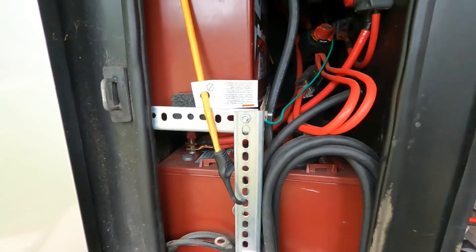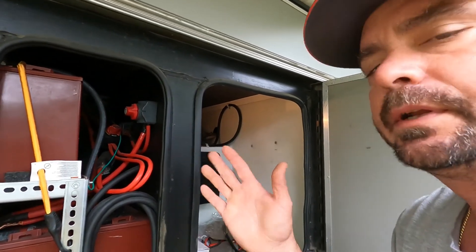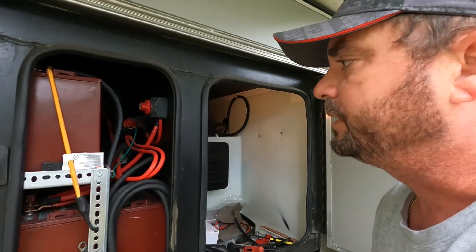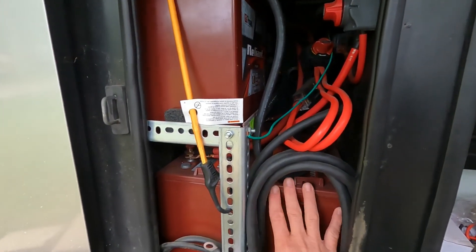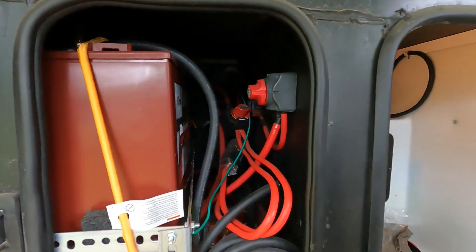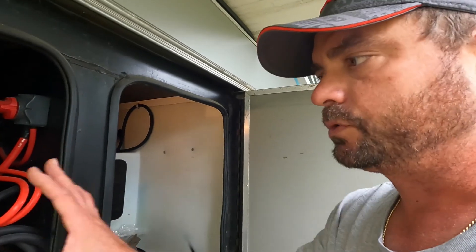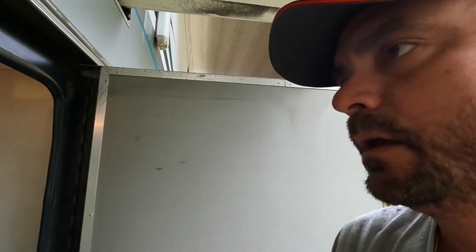You can see here this is kind of a mess, but we took out the two coach batteries. This rig originally came with two 6-volt batteries, and we did a lot of research. In retrospect, we probably should have gone with lithium, just for weight, not so much for capacity. But these will last us a long time because they are 6-volt deep cycle AGMs, and we put six of them in here. I can't remember the amperage rating, but it gives us a decent amount of power — we're able to run the fans all night and cook with the microwave. It was a good choice at the time. The RV will charge the batteries from the generator, from shore power, and from the alternator. It's convenient, but this third inverter is a pain in my neck at this point.